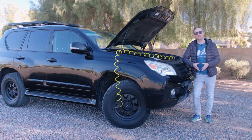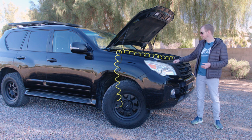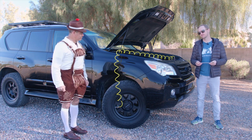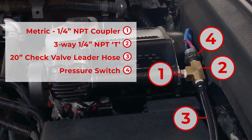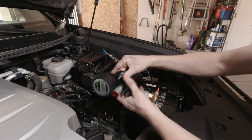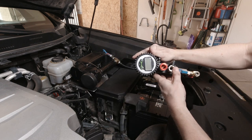In the previous video, I converted the Smittybilt's closed flow metric fittings to quarter inch MPT open flow fittings. I also added a stainless steel leader hose at that time. You're going to want to choose a leader hose for this particular application. Check out the links below for the special quarter inch MPT to metric coupler that I used to make the conversions. I also added a three-way fitting at the compressor to accommodate the pressure switch. For the permanent install under the hood, I changed the leader hose to a 20 inch check valve leader hose. The check valve hose will keep the air from leaking back out through the piston and causing the compressor to cycle on and off every 30 seconds or so. I also put a quick disconnect on the end of the leader hose to be able to connect it to my manifold while maintaining the ability to easily bypass the manifold or change the battery in the field.